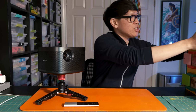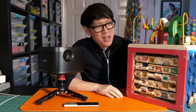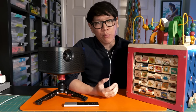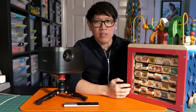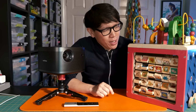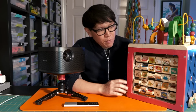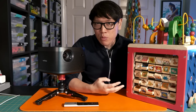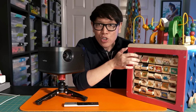screen is this children's toy I can bring into frame. I have children in the household. When you look at the DLP chip, what it actually is, it's an array of micro mirrors. So you think of this square right here representing what you would find on that small, maybe half-inch or third of an inch DLP chip. In there, depending on the native resolution of that chip, you would find millions of these tiny mirrors that at very high refresh rates, many, many times a second, can actually articulate and actuate.